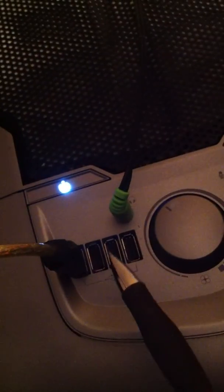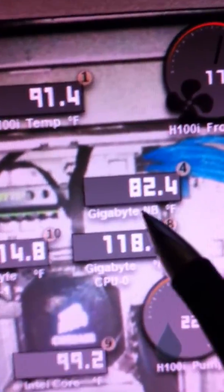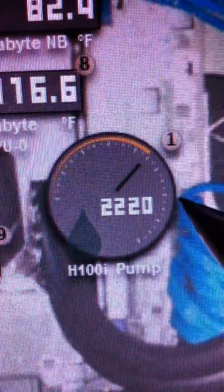The external hard drive does not seem to compete for resources with the H100i. So what I did was I plugged these two back in afterward and the H100i continued to work. Just to test things out, I took the mouse out of here and plugged it into here while the computer was running, and the H100i software — the fan and all the stuff related to the H100i on the software — it totally froze.